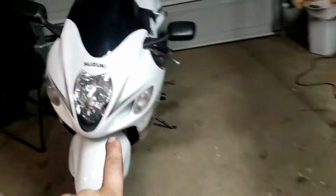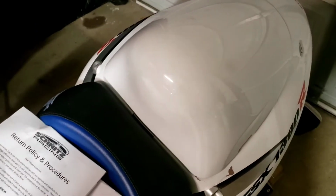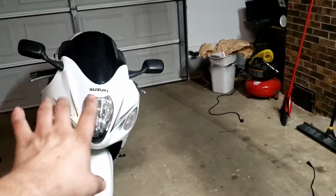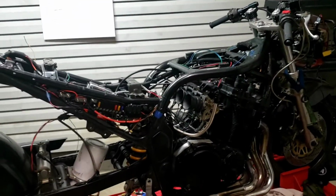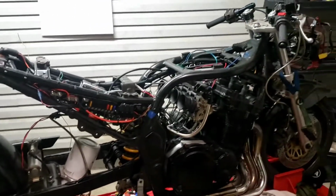This bike sprays at 5,000. It does not have any circuits to protect that, so I can spray it right now with the engine off. That needs a window switch. I got to look into it. Before I let Junior have that on nitrous, it needs a window switch. Then we can just arm it and spray it.